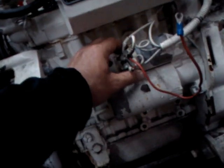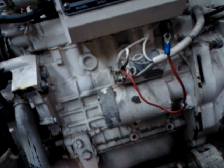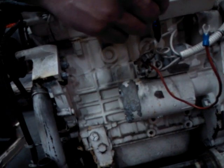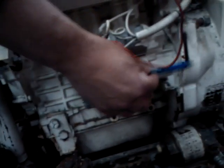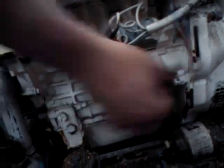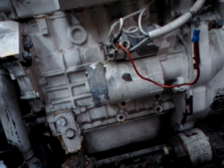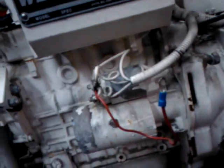And then the starter is over here, right? What's this other thing on top of it — is this a starter solenoid? That's a solenoid. So there's a starter solenoid and then the starter itself. When you engage it and you put juice here, it's going to shove it forward, which shoves the armature out here, hits the flywheel. There's a gear in there that just shoves up against it and then it rips off.